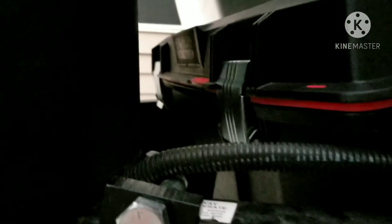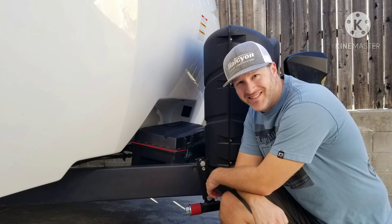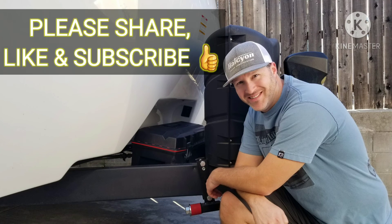These AGM deep cycle batteries are really solid — it's a true deep cycle. I went with a single 12-volt rather than two 6-volt batteries so that if one dies, I don't have to track down a matching 6-volt; 12-volt batteries you can pick up anywhere. Hope you liked the quick video — if you did, click like and subscribe, tell your friends, and thanks again.